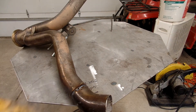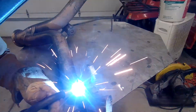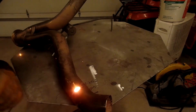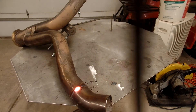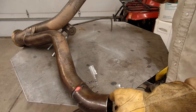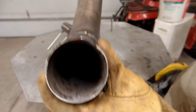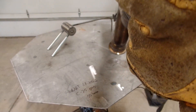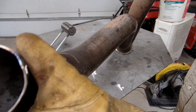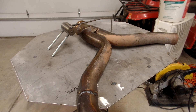See that — that burned a hole. A couple tacks, fill it in, you're good to go. Now like I was saying earlier about the penetration on the inside — I can see penetration pretty much all the way around inside of there, so it's not going to come off. It could crack years down the road, but by then he'll probably have wrecked the car 14 times, so I think we're okay.